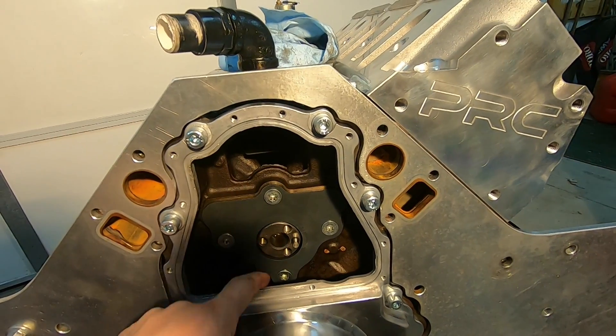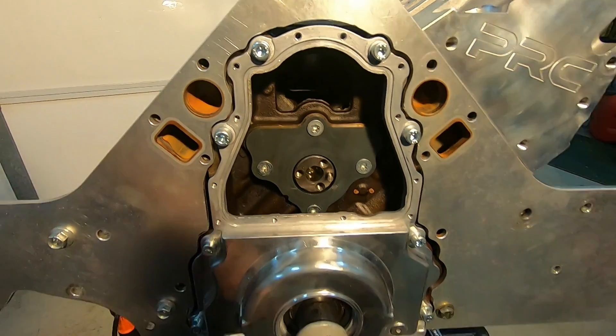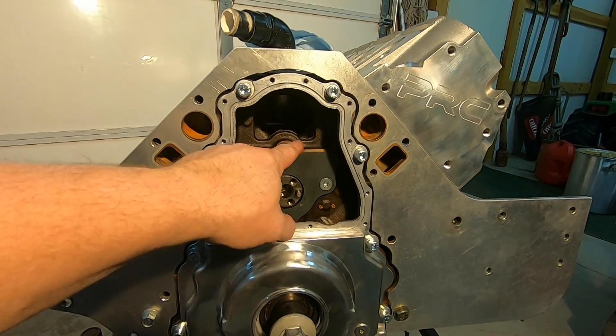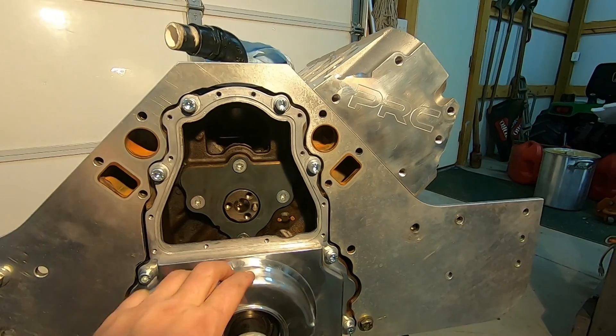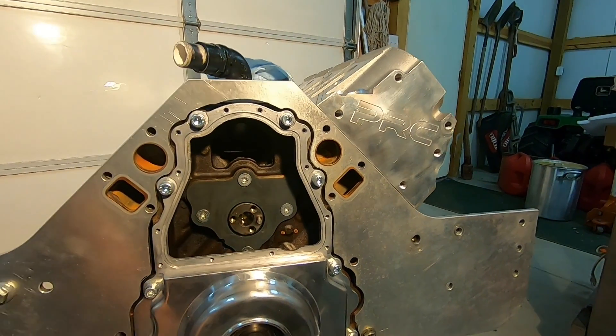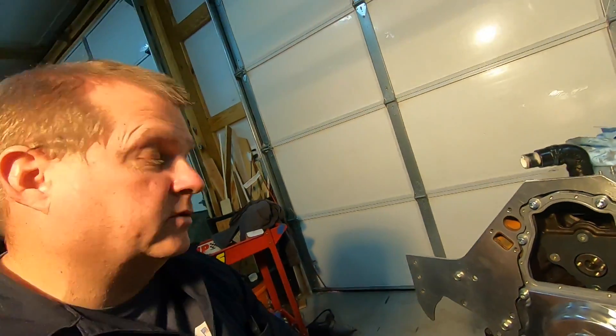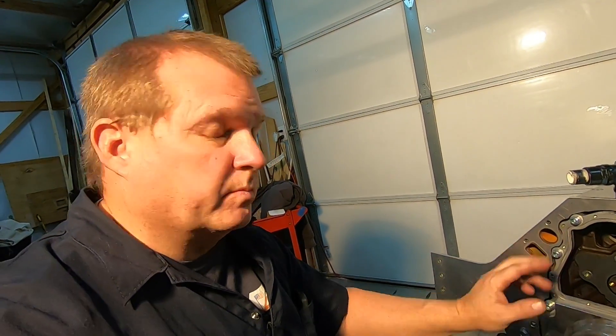I don't think I can pull the cam out without pulling the timing cover out — at least for me. Is this going to be easier or not? If you can get that bottom bolt out, once you get the retainer off, the cam should slide right out. But it also depends on the size of your balancer — if it's anything bigger than the bottom of this right here, I don't know if the cam's going to be able to clear it. After seeing this little demonstration, if I'd known that, I would have just gotten a single piece and dealt with pulling the balancer off. Getting the balancer off is not that difficult — they're easy to pop off, just a little bit more work.